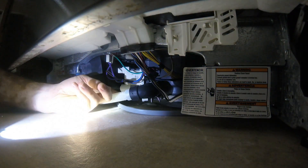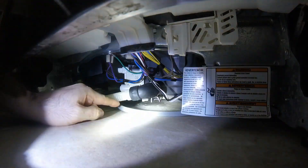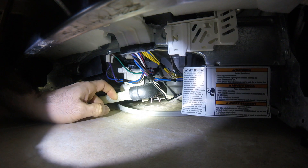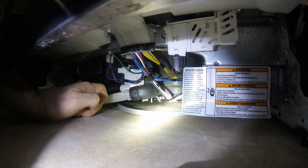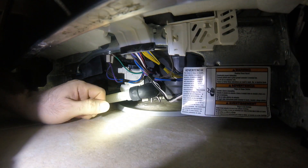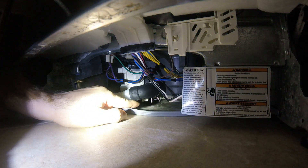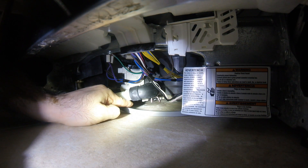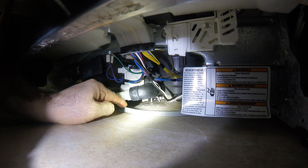You see there is a little motor kind of thing here. Typically the other kind of leak happens right under that motor. You'll see a little drip of water coming down from there once it starts going. This particular leak happens when the dishwasher is in use and going through the wash cycle as opposed to the fill cycle. So you'll see a small drip of water coming right underneath — there you go. See, there was one drop right there. You should see more drops — there we go. A whole bunch of them coming because the water started spraying now.